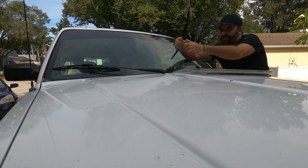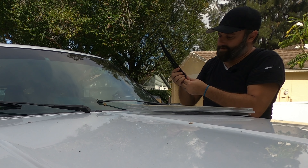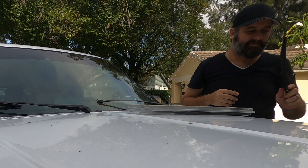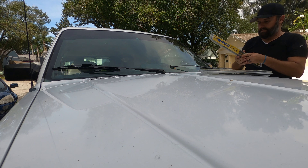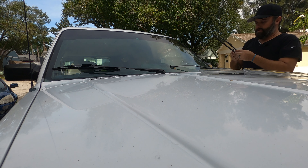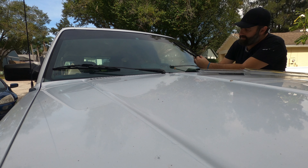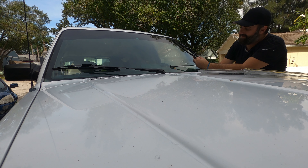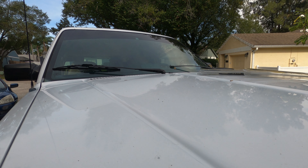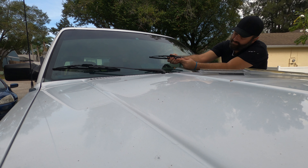The windshield is clean and dry, and the button is clean and dry. For good measure I also like to take it and run it across a piece of sandpaper to score it up a little bit — gives you your best shot possible. Another quick tip I've learned the hard way: make sure you glue this thing on there the right way. The skinny part goes up and the tapered part goes in. It's pretty obvious which side is clean and shiny, but just make sure you get the right side pointed up, or once again you have to go back to the beginning and start all over.